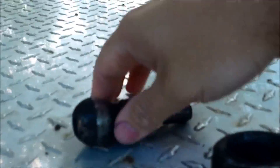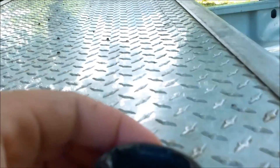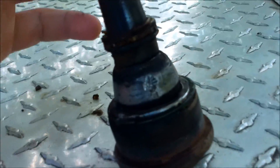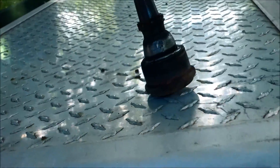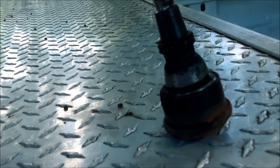So this is the Ford Crown Vic ball joint that came out, and what you will notice is there is no grease fitting on it at all. From what the mechanics told us, the '99 ones and around that year model, they did not put a grease fitting on it. So eventually you got water in there, couldn't grease it, and it popped out — and could have killed you.